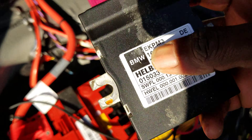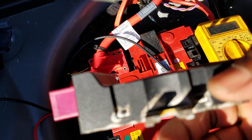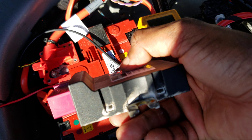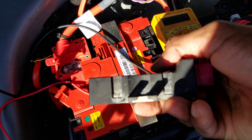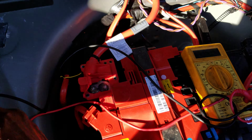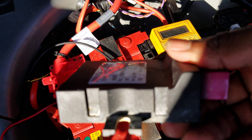One more thing I want to show you — see this fuel pump? If you look at the orientation, you can see the swelling. It swelled up because it got hot and water got into it, and gas developed inside. You can see the top is not flat — it's rounded, it bulges right here. Compared to the flatness of this module, which is completely flat, you can clearly see the fuel pump module has a round bulge.